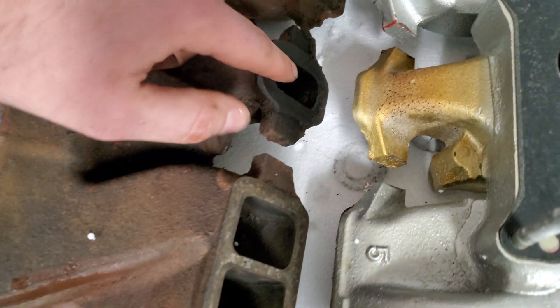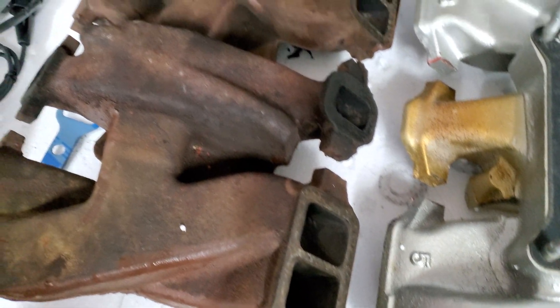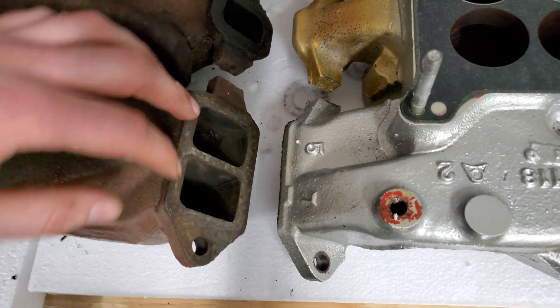That's a quick video — I wanted to show you guys because some people aren't up to the task of modifying these Gen 2 intakes, and as I get closer to doing it I don't totally blame you, but it is something we're going to do. If you want to go in here and clean these up, you can skip the middle because that is a crossover — it benefits you in no way to modify that. Just do the outside two on both sides and I think it'll help you out quite a bit.